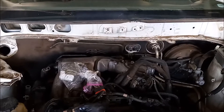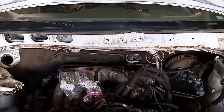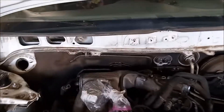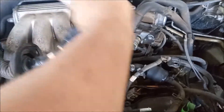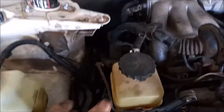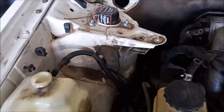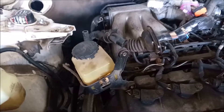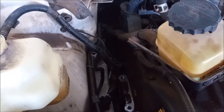Let's go through all that we did in order to get ready to drop this engine and transmission. First, we've removed the windshield wiper assemblies and the windshield wiper tray. Then we've gone through from the glove box area and disconnected the harness from the ECU and pulled it out. We've disconnected the power steering fluid reservoir from the frame and pulled it up to the side. We've removed the alternator and the side mount or torque mount from the side of the engine. Over on this side we've removed the battery.